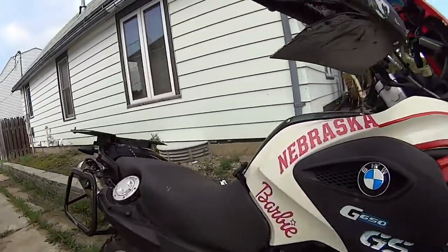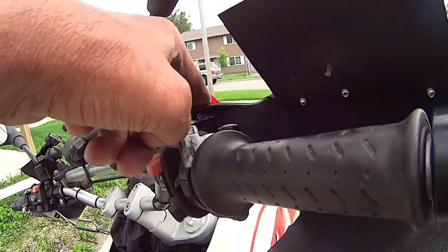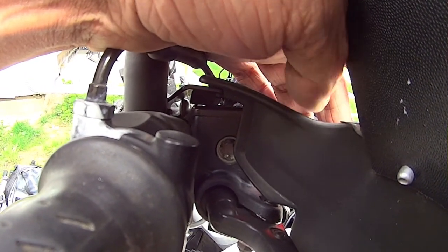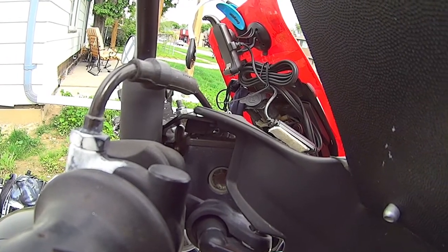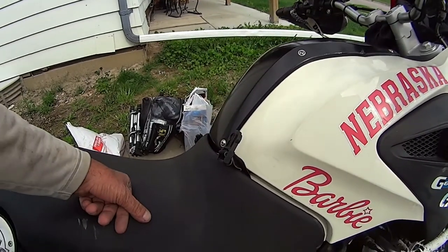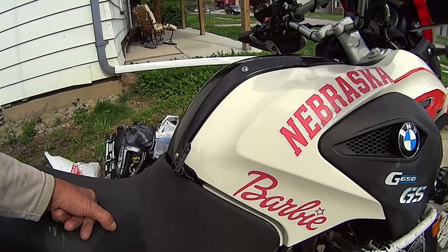Interesting thing, when I did the rear, it did not suck any brake fluid out of up here. And I don't know if you can see this. It still looks black to me, but I guess that's just how they roll. I don't know if I got the brake fluid completely out of the ABS pressure modulator, so I'm gonna have to go back in and look at that.